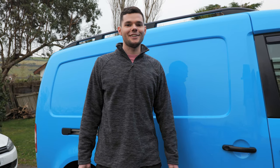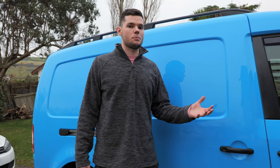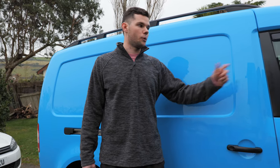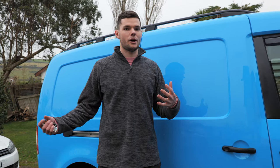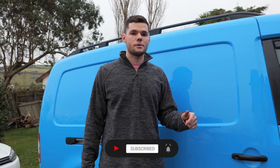So that's the end of the video. I hope that's helped you out with condensation issues in the winter. The main thing is obviously ventilation — if you get ventilation in the van, that's going to reduce condensation. The cheapest solution we've found is buying a condensation bag or dehumidifier bag, which is essentially the same thing, at about £15. For a van this size you'd buy two of those bags — put one at the front and one at the back. If you've got a bigger van, maybe buy three or four. If that's helped and it's added value, hit that like button and subscribe to the channel.